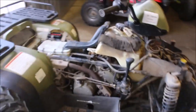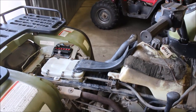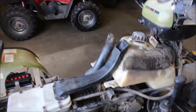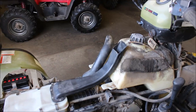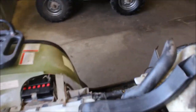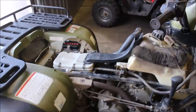Like I said, with these CV carbs it all depends on your fuel-air mixture. If that isn't perfect, this thing will run like crap. You might be scratching your head wondering what the heck. There is the air fuel mixture screw at the bottom of the carb — make sure that's adjusted correctly because that will throw you off. All I did was swap out the airbox. Everything is sealed tight now. It actually has a decent snorkel coming up the top instead of that goofy one coming out the side like the '97 has.